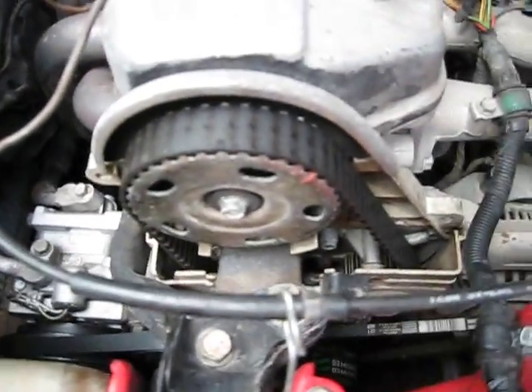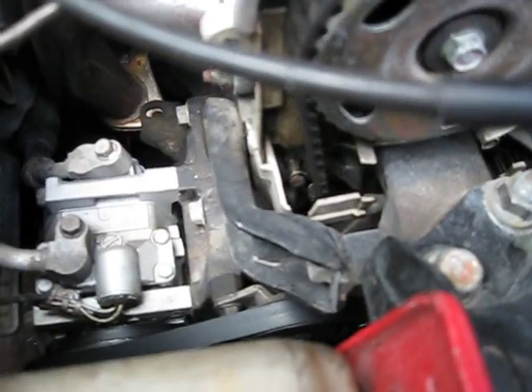Then come around to this side of the engine. I never put my plastic cover back on so I could always check the tension and see if anything was rubbing. The next thing you're going to do is remove your timing belt. Once you have the car jacked up, there's a series of bolts down there that hold the covers on — take off all those covers, then loosen up the tensioner and remove the timing belt.